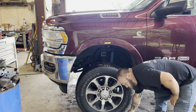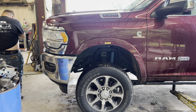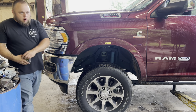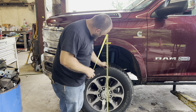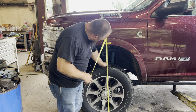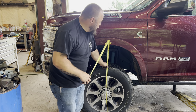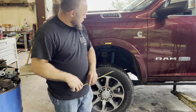Back on full weight — let's grab the tape. Our earlier measurement was 40 and a half inches. The new measurement is just a sixteenth of an inch short of 44 inches, so that is about dead-on three and a half inches of lift — which is exactly what they advertise.